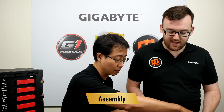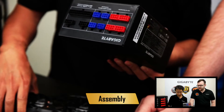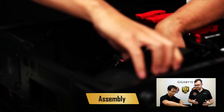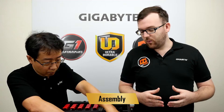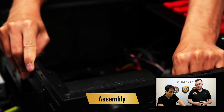This here is a modular power supply. When we say modular, that means it has all these plugs in the back, so you only have to plug in what you need. On a non-modular PSU, you'll have all these cables — the problem is, if you don't need all the cables, you have extra cables which might impact airflow. That slides in nicely down there, and once it's lined up, you have to screw it in. Once that's plugged in, we can plug in all of the cords to the back of the PSU. With a modular PSU, you only have to plug in the cords you need.